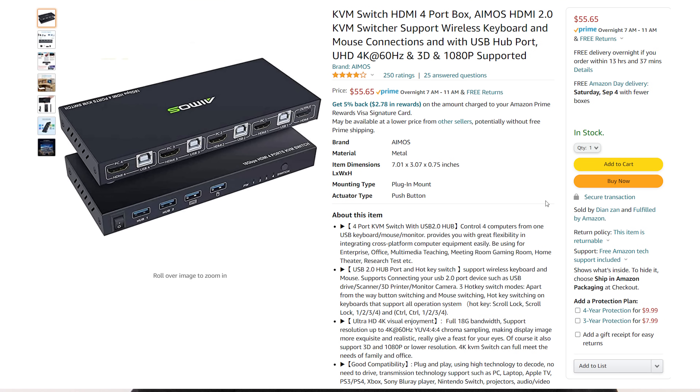However, this is an HDMI 1.4 rated device, which means 4K 30Hz, not 60Hz. If you have a high refresh rate monitor connected through DisplayPort, this may not work for you. It was designed for 1080p 60Hz, though it will do 1440p and can do more than it's rated for. If you have a 4K monitor or a high refresh rate 1440p monitor, there are HDMI 2.0 KVM switches — I'll link those in the description. For about $35 on an HDMI 2.0 switch you get a two-computer switch instead of four; you'll spend around $60 for a four-computer HDMI 2.0 switch.